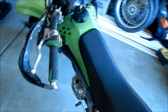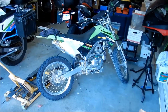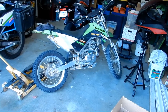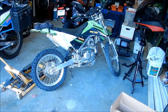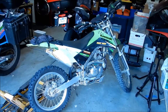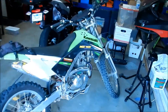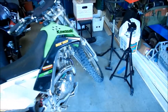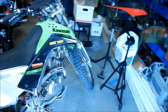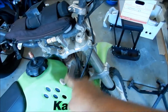So there we go — that's a quick solution for those of you that have upgraded your KLX140, the L or the regular KLX140. I'm not sure if you'd do it on the G. You'll have a problem with the top clamp hitting it. Those of you that have done this mod, let me know if you've run into that problem, because that's the problem I'm having. The top triple clamp bolt here is hitting this.